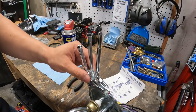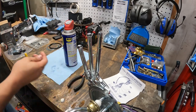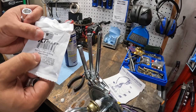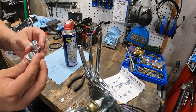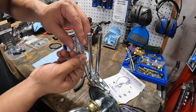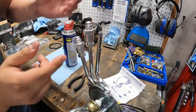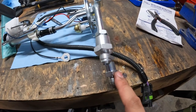Now that we've got that connected — I'm running AN lines and you've got two options. You can either cut the line and put on a compression fitting, or you can get these slick units from ICT Billet. Instead of having to cut that line, you just put these on there. The part number is F06ANFM1415 — I'll put them in the description. There's a feed and a return; you grab the larger of the two, which is the feed, and just screw it on. That way you can retain the factory-style connector and change it over to AN line — a perfect, no-nonsense, easy connection upgrade. One fuel sender ready to drop in the tank, and these fittings are going to make the rest of the install a breeze.